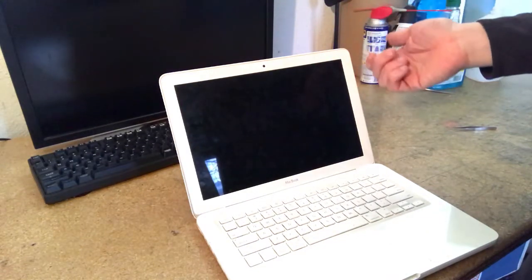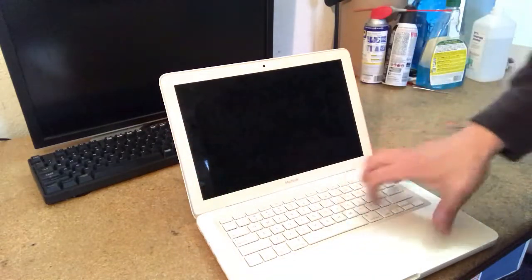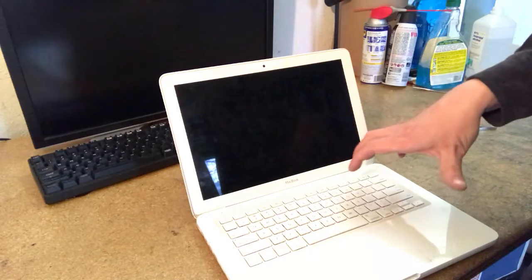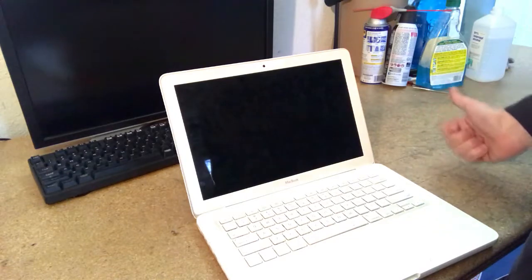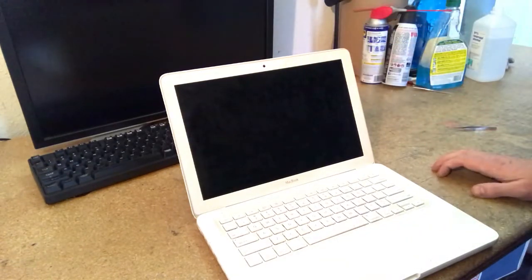And if replacing the webcam does not do it, it could either be the internal cable that's at fault or the board. Sometimes the board actually is at fault in such a way that it cannot receive a signal from a webcam. But in this troubleshooting process, obviously the first step is to just disconnect and reconnect the webcam.